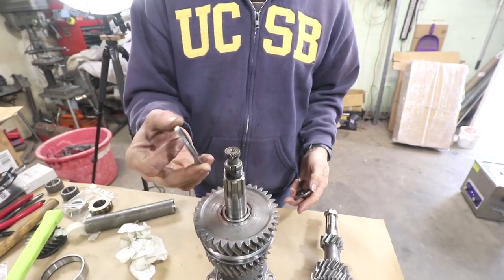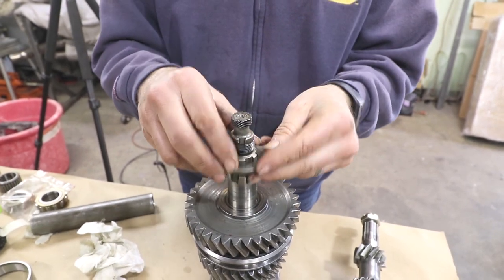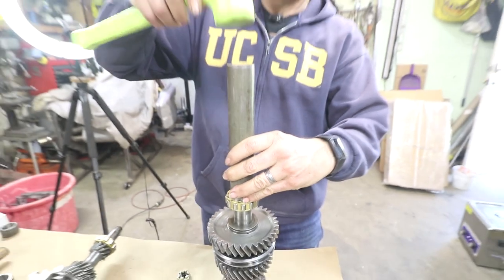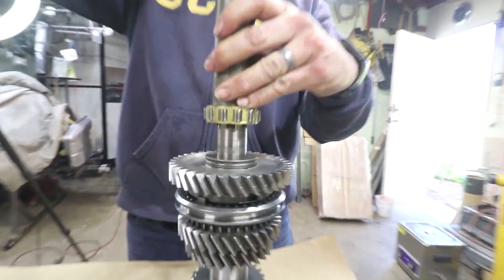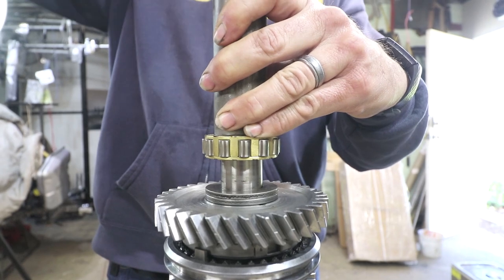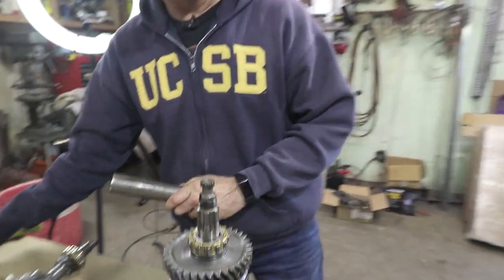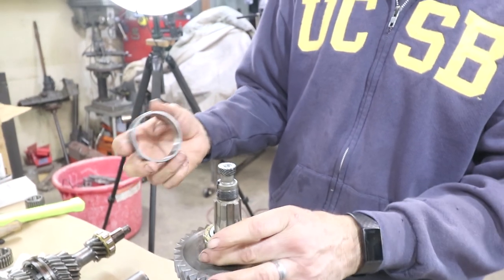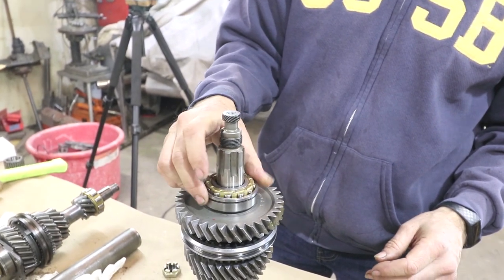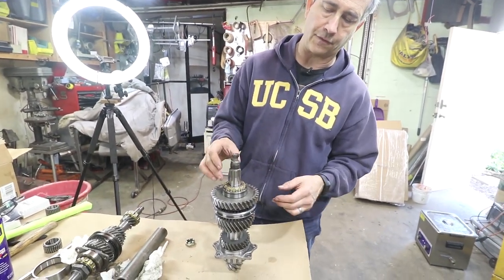And now first gear — also spins well. What I have here is two thrust washers. Once again lining up the wear patterns. I'll try to tap this new bearing down — just got to go a little bit. And then this is the race — we'll put this in a baggie, but this goes in the transmission housing. Spins just like that. And that's as far as we can assemble this until we get it in the housing. Then we can add on the reverse and fifth gear.